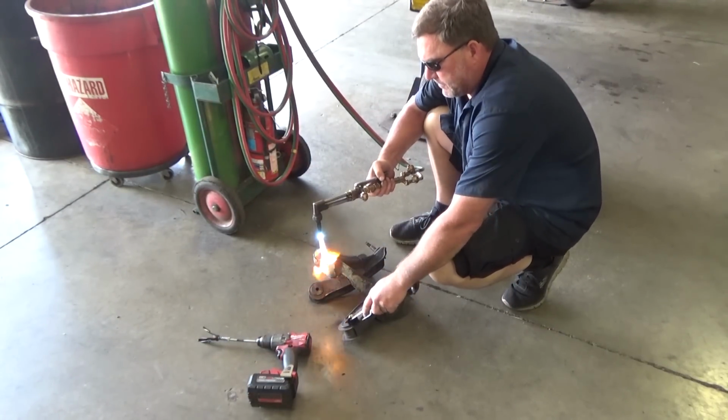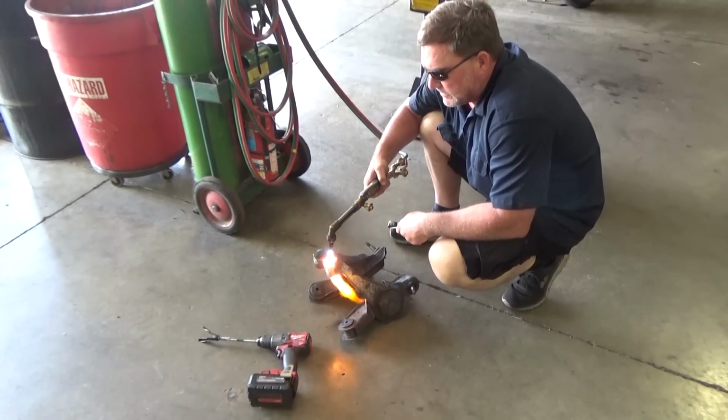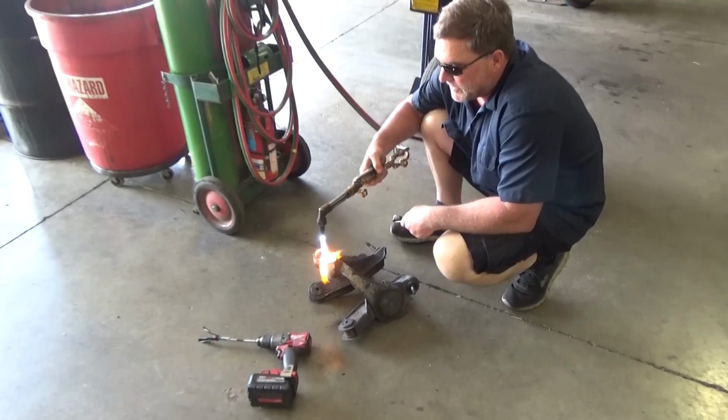I've already got my forward bushings installed. My rear bushings are being a problem. The bushings I ordered for it are incorrect. So I'm actually going to try and make an aluminum bushing for it, which will be really rigid, but it's a race car, so it'll be fine.